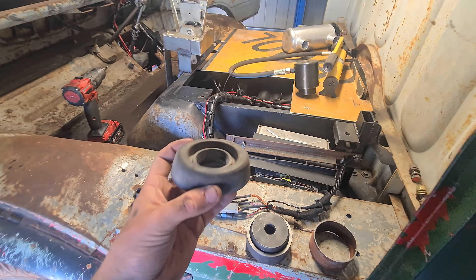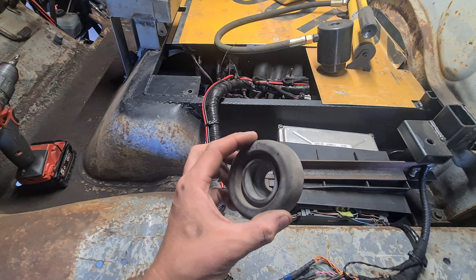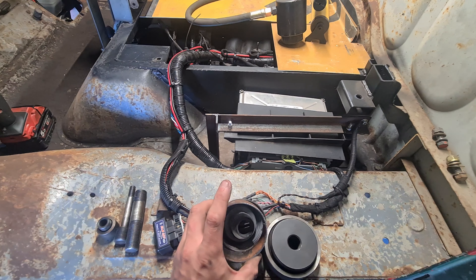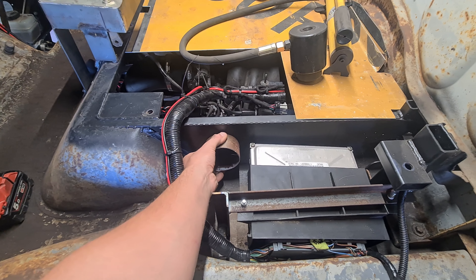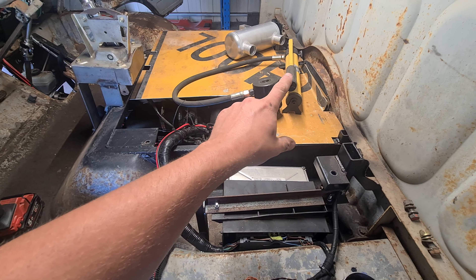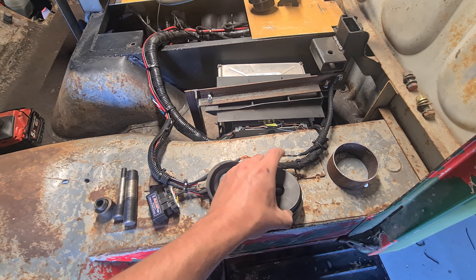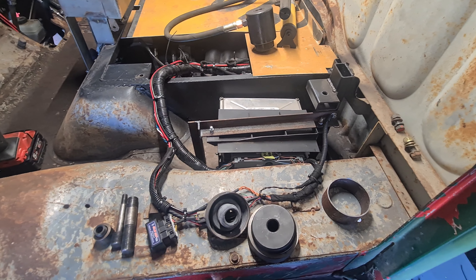It's a new day. I finally went to the wreckers and got a grommet — it's off the back of a headlight, all I could find that was the right kind of size. I've got a piece of pipe cut to the right diameter that goes inside that grommet nicely. What I need to do is cut a hole through here and weld that in. I'm going to use this dimple die cutter — there's a port-a-power type thing, and then the two die halves. It just puts the material between those two, pulls them shut, and it puts a hole in it.